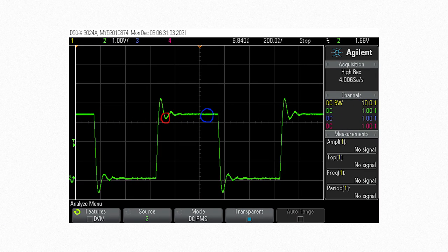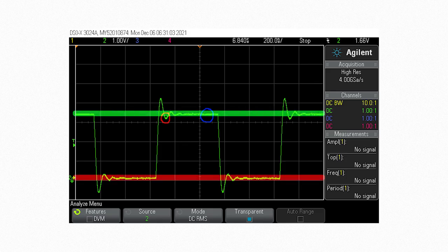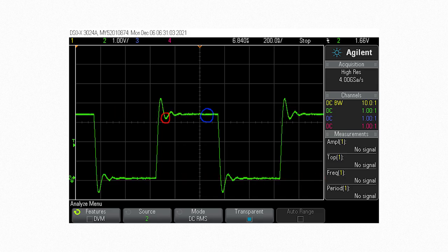Let's discuss edge and level triggered modes. If you probe any digital circuit with an oscilloscope, you will see two voltage levels — a lower level and a higher level. An edge means a transition from either low to high, also known as a rising edge, or high to low, commonly referred to as a falling edge. Edge triggered mode means the PIC will trigger an interrupt on the CPU when it detects a rising edge. In level triggered mode, an interrupt will be triggered when the PIC detects a high signal. The most important question is: does this matter and how will it influence the way we write our interrupt handlers?